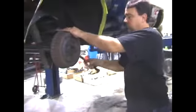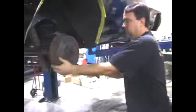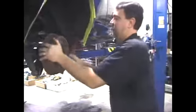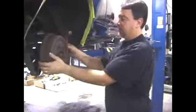So the first step is to pull them. That didn't work. Then you tap it gently with a hammer. He grabbed a steel dead blow hammer. That was handy. You won't hit it very hard with a steel hammer because you can break pieces of that cast off real easy. Who cares? We're throwing the drums out anyway, but it's just dangerous to break them.